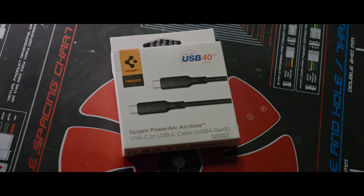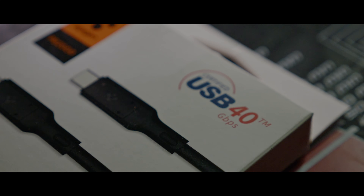The dock comes in a small cardboard box with a piece of foam — it's $46, so we didn't come here for greatness. One thing I didn't mention: the cable that comes with it is not high quality. When I originally hooked it up, it would do 1440p but only at 60Hz, and testing at 1080p it was still 60Hz — the refresh rate would not increase no matter what. So I bought a USB 4.0 40Gbps cable for $50 after shipping. This cable cost more than the entire dock, which speaks volumes about the quality difference.